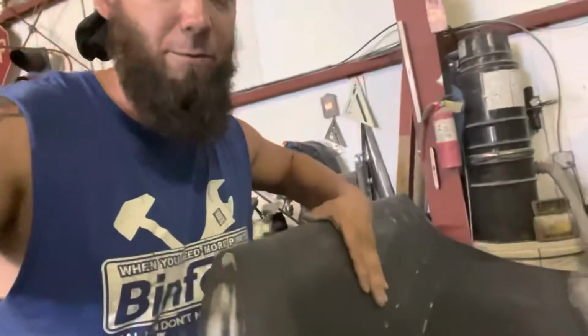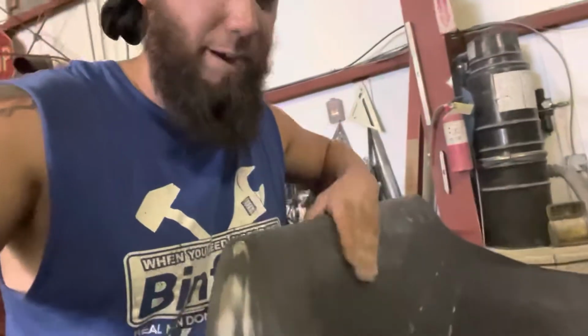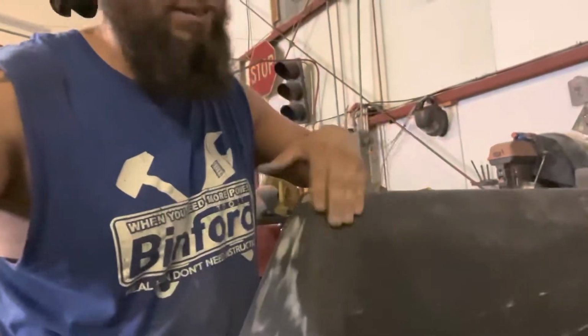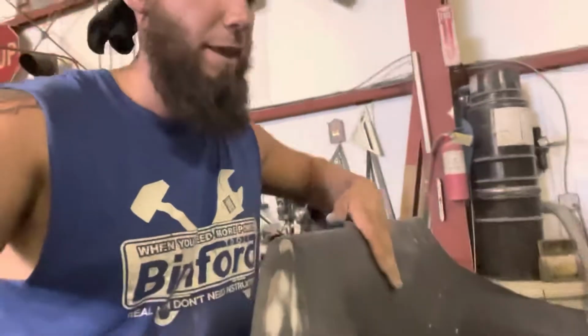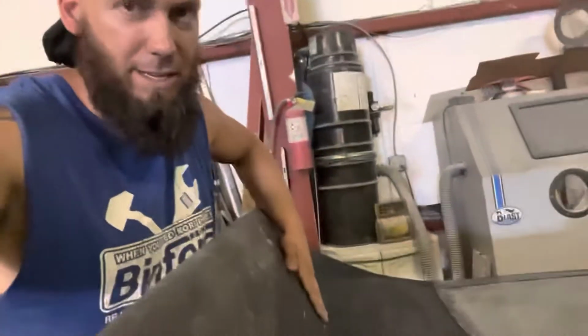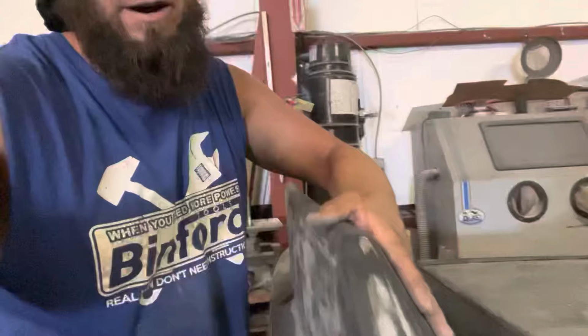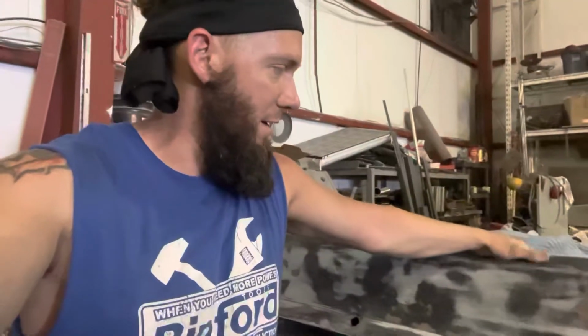I think I was hitting this with the 400. It's smooth where I hit it, but it isn't cutting it down, as you see. Not sanded and sanded, so the 400 wasn't cutting it. But the front, I can feel that it's kind of wavy, especially in this little area. Yeah, man, I gotta have a body shop finish this 100%.